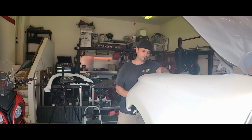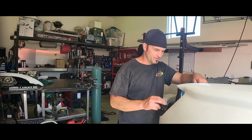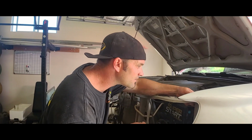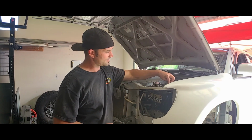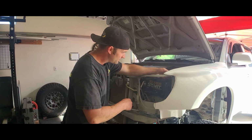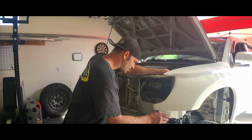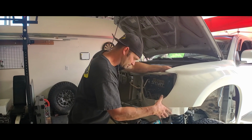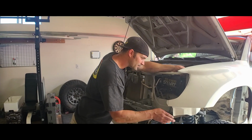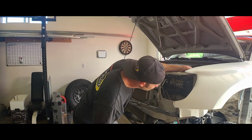Front, you have all your same mounting points. Those 3 bolts here. Looks like this is a little longer, meaning this piece sticking out right here coming into the engine bay. So I may just want to trim that to get it out of the way. And then these 2 bolts mount up right here, and then you could probably put the 3rd one in right up on top.